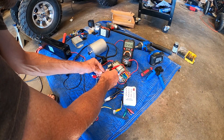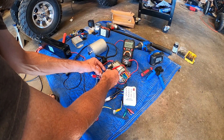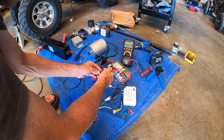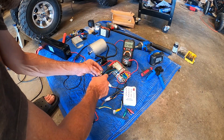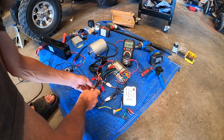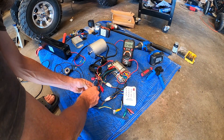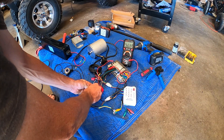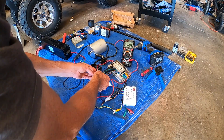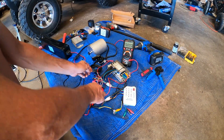Probing this connector - one pin is battery negative, one shows 0.4 volts, one shows nothing, one shows battery voltage. I'd suspect something like a yellow-green wire could be a brake light. To test it, let's just short it - and look at that, the light comes on. So when you push your brakes it closes the circuit and sends power back down the yellow-green wire. I've seen yellow-green as brake light wiring so many times across different controllers - it seems to be a common theme.